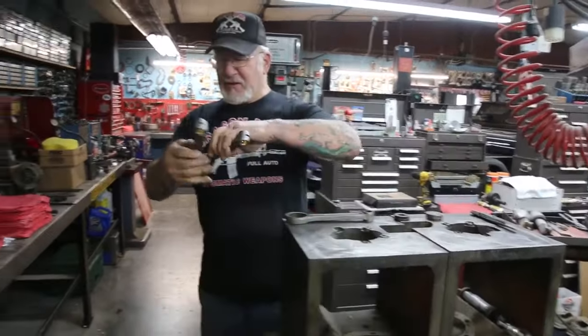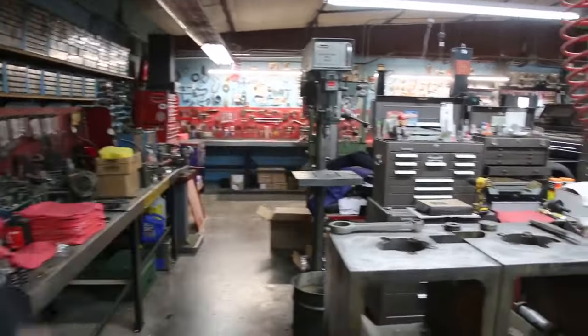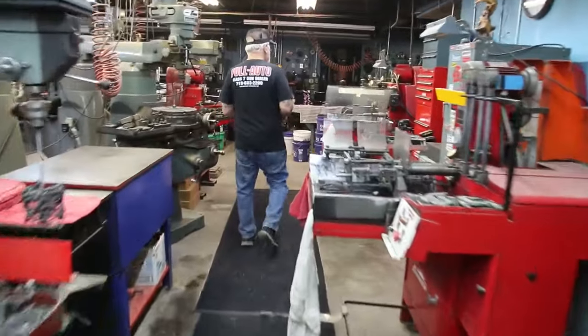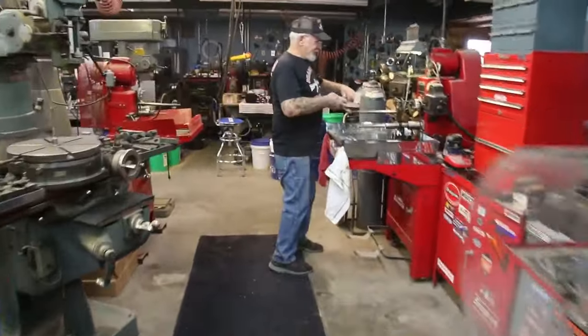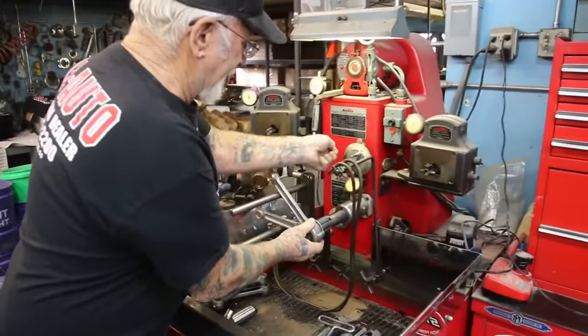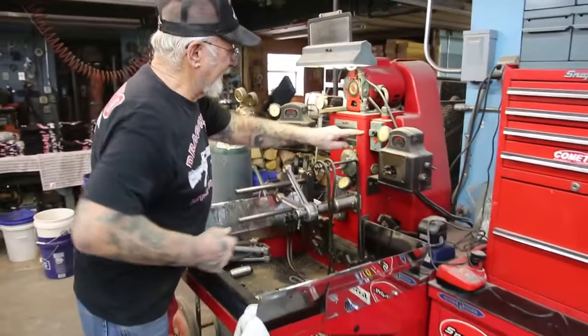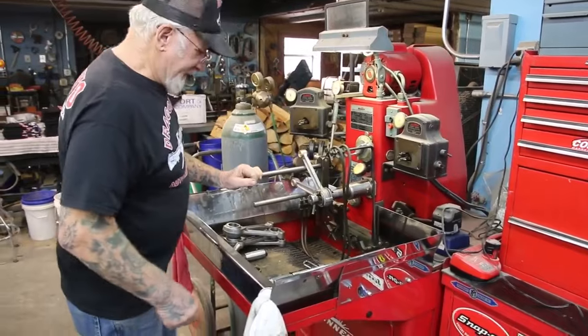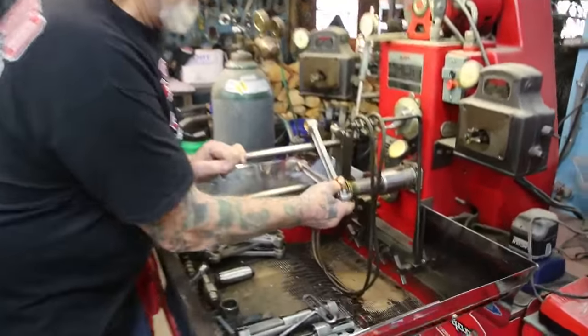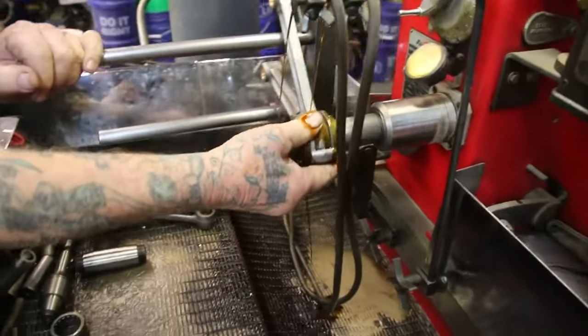So now after the racers are in, we go to the honing machine — follow me. This here's a rod reconditioning machine. I've got the right mandrel in there already. We put that on there, push the button, and hone it out — back and forth until we get the right measurement.